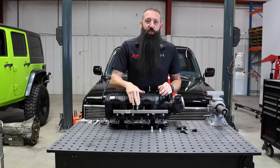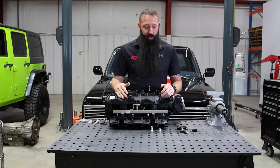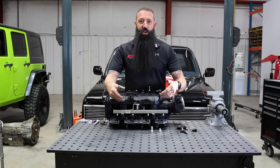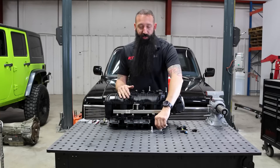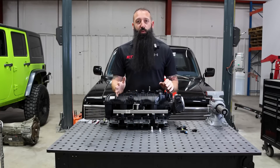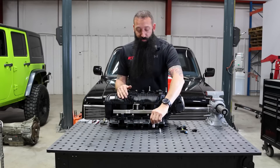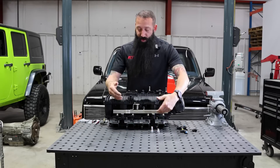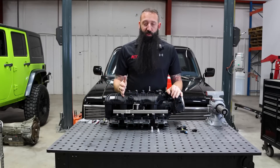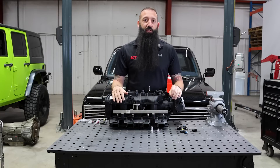The common question you'd get is: why don't I just buy a fuel injector that fits my fuel rail and intake? Well, sometimes you want to run a GM fuel injector and you can't find the right one for that spacing. This is where our injector spacers come in handy — you can put any brand of fuel injectors. Some people have certain brand preferences, and this allows you to run whatever brand you want and it'll fit any of the intakes. We have a handy little guide that makes it super simple to figure out what fuel injector spacer will go with your intake and fuel injector combination.